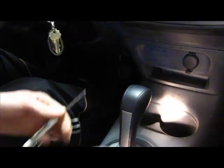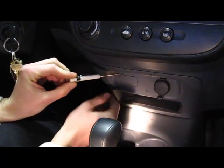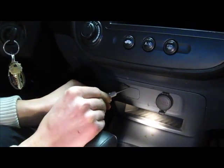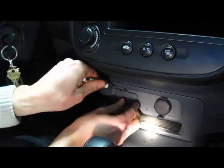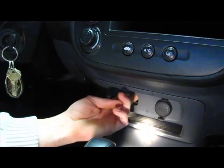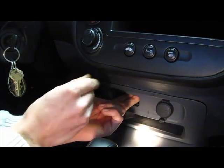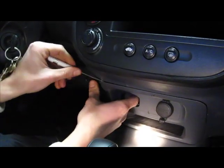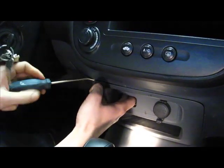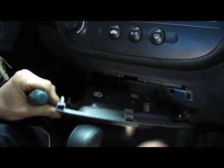So the first step: you take your small screwdriver and put it here in the middle — there's a blocker piece. You put it in carefully so as not to scratch any plastic, and this cover pops off just like that. You take this cover off in order to put your two fingers inside and pull this whole piece toward yourself. You can use either a small screwdriver or a clip removal tool — I'm going to use the clip removal tool. You pull it toward yourself and just like that it comes off.